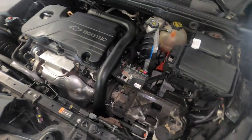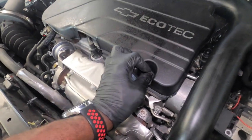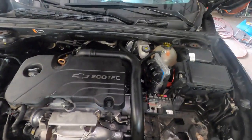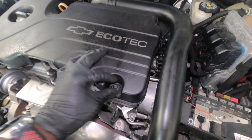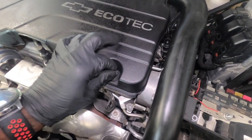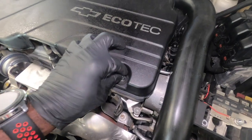The next step is to take off your engine cover. This is a torx screw. I think it's, let me double check and get back to you. To remove your engine cover, it's going to be a T30 torx. Link will be in the description for that as well.